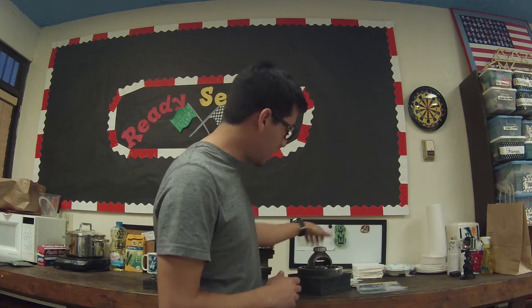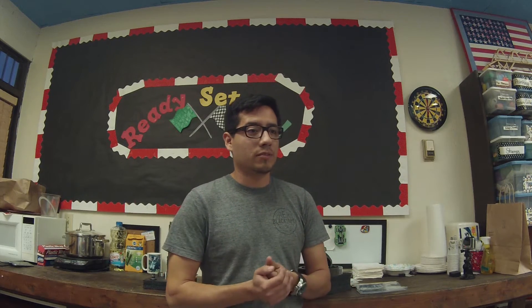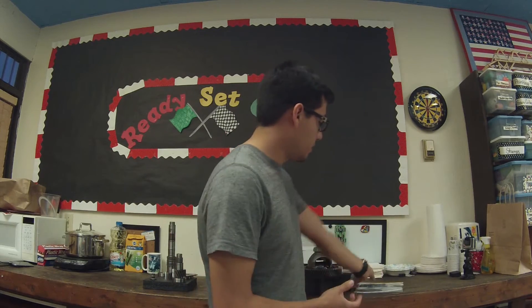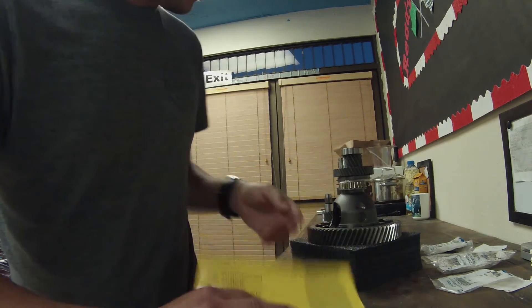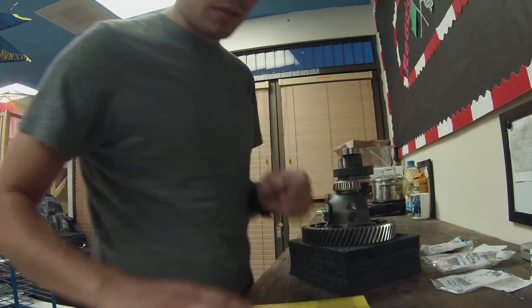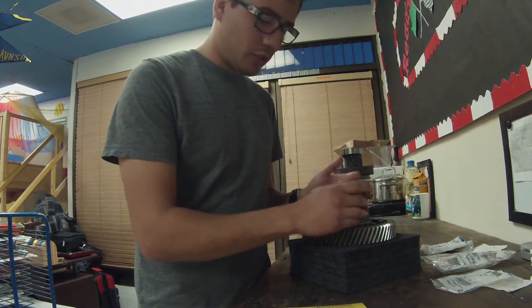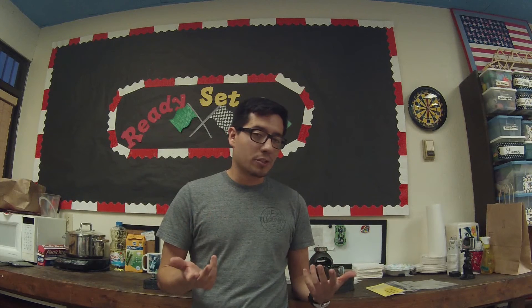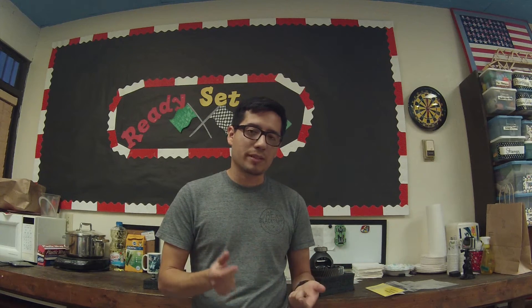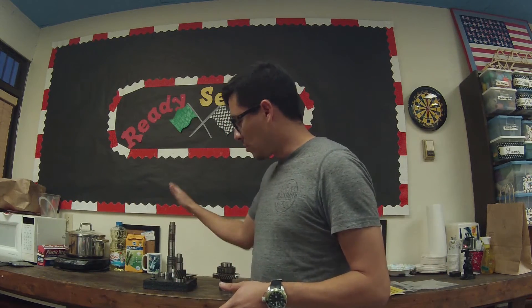The Wavetrac is at home right now — we're at my work. To replace the LSD, I went with a Ford Performance or Mountune kit. Inside the kit comes all new axle seals, the hardware or bolts for swapping out the ring gears, and also what you don't see in the bag but is new races, which we've already installed as you saw in the last video. Along with possibly some shims after you do your measurements — fortunately for me I didn't need to change the shim, so I bought all the shims and can return them.